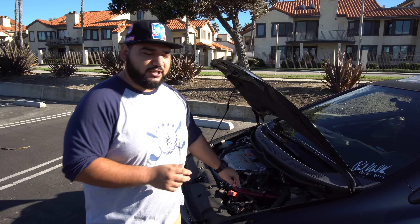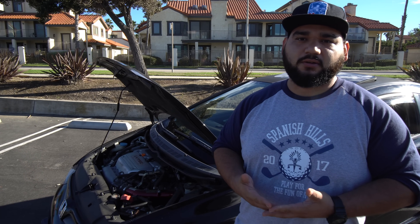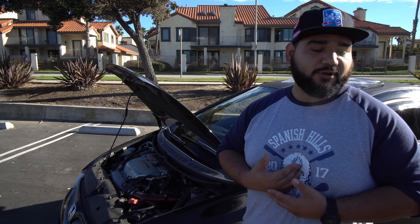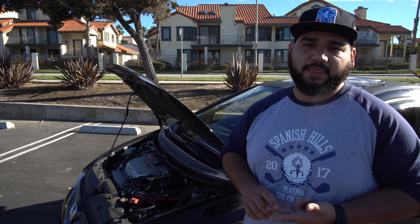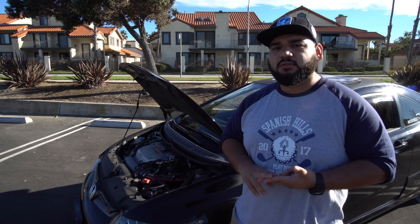The reason I'm mentioning the cable bushings, base bushings, synchros, and all that is because a lot of 8th gen users like myself look into those before trying to swap out the clutch master cylinder or replacing synchros. If you can avoid getting new synchros or swapping the CMC by doing all this instead, you should be fine. That's what I did — I did everything except the synchros and clutch master cylinder, and the car is good with no more grinds.